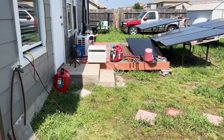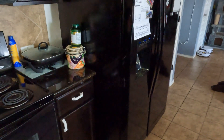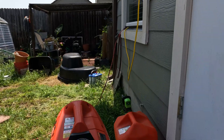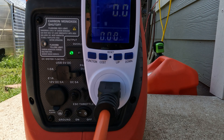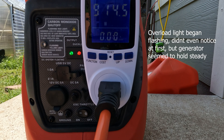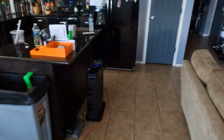Got the extension cord and watt hour meter plugged in. The fridge is currently running so I'm going to unplug it and let it sit for a minute so the compressor won't immediately kick back on. Starting the generator back up, plugging the fridge in, and going back inside to watch the watt meter. I can hear the generator ramping up. I think I saw 900 watts for a second — it ramped up then back down. Checking if the fridge compressor is actually running.